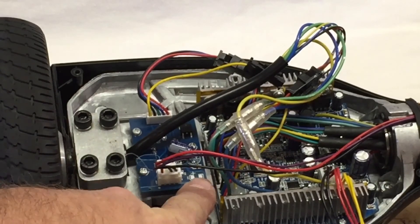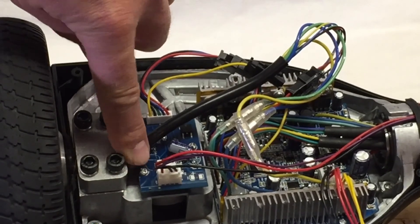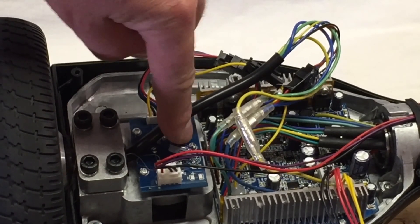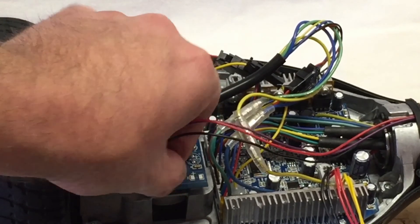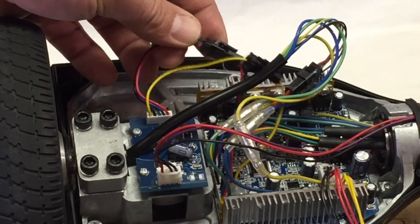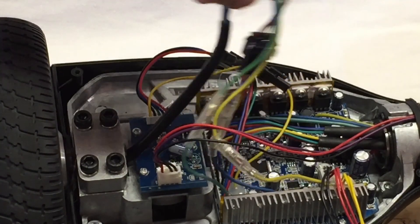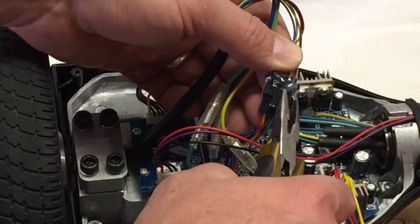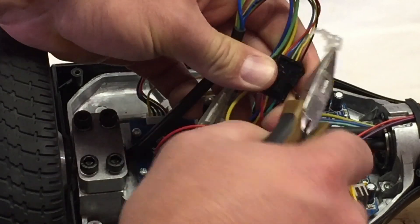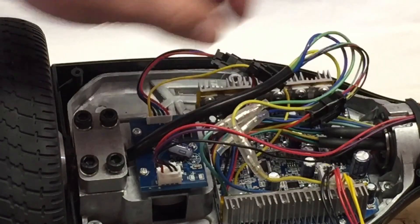This is the sensor we are going to replace. There are three screws on here — one, two, and three. There is this wire connection here and then there is a connection right here. I have already peeled the glue off. These hoverboards come with connections that are glued on; for example, this one for the wheel. To undo that, you just take a pair of pliers and peel it off to get the connection undone.